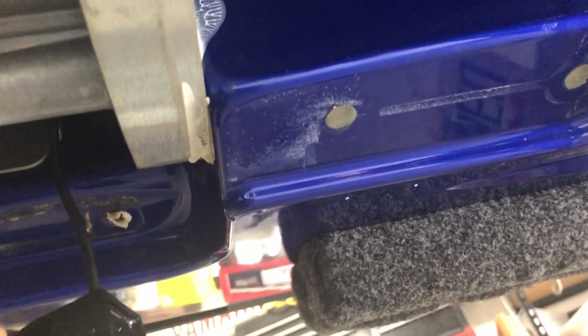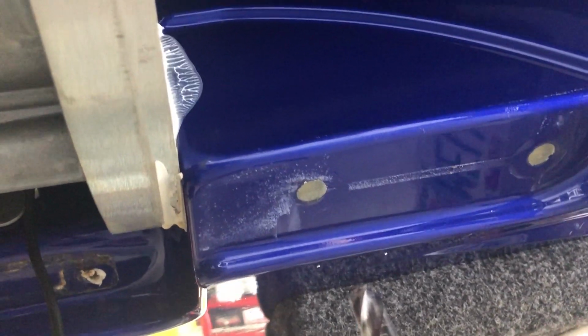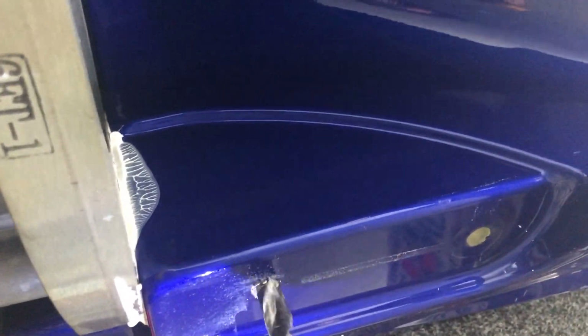After you have confirmed that the epoxy is starting to set up, take your 29/64 drill bit and re-drill the holes, taking care not to puncture any of the outer liner. Next, we will begin the reassembly process.